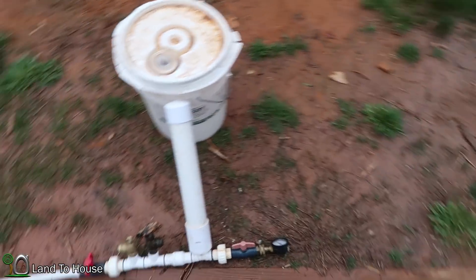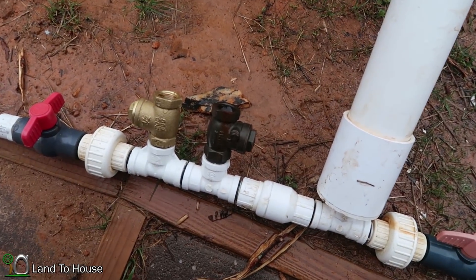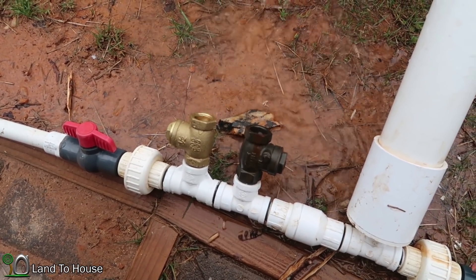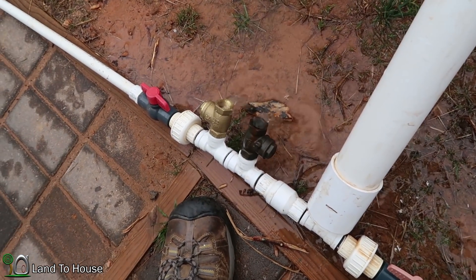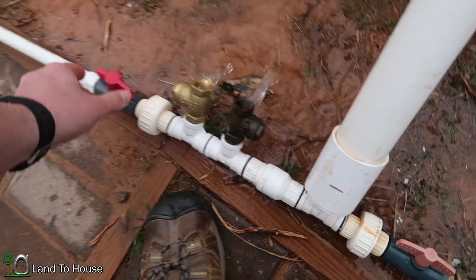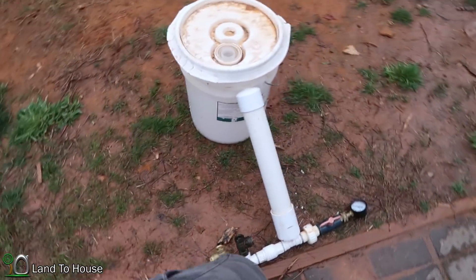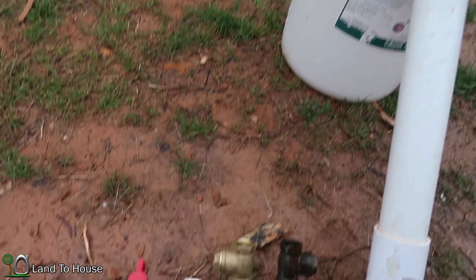There is a technique I've learned when working with low head pressure systems, and that is to tilt the check valves far to the side. Now, this does reduce the efficiency pretty significantly, but as you can see, I should be able to get both of these running now. It's definitely inconsistent because of the angle, but it's working. So let's run this test again. I have the water at the top of the bucket coming down the same drive pipe length, and I have the pump tilted so that it will be able to start with less water.